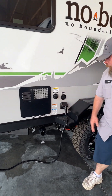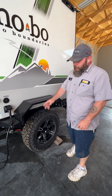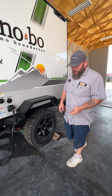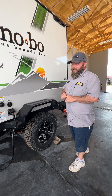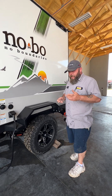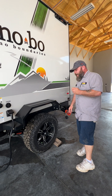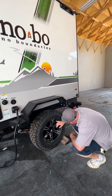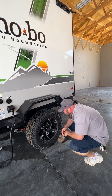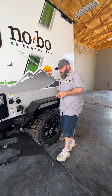This notice sticker here is for your tires — make sure you check the lug nuts periodically. That is recommended at 50, 100, and 200 miles, and you want to make sure they are torqued to 100 foot-pounds. I always like to say when you leave the campground, usually your first stop is the gas station — while you're refueling, you can check these lug nuts, knocking out two birds with one stone. You also want to keep the tires topped off at their max PSI — I believe these are 80 PSI — and the nice thing is you have that monitoring system so you can see tire pressure.